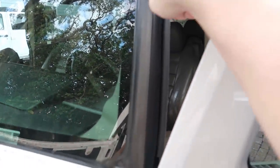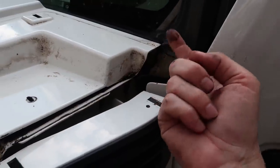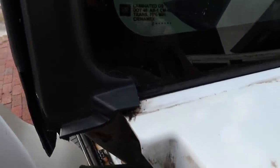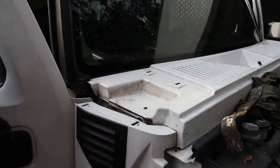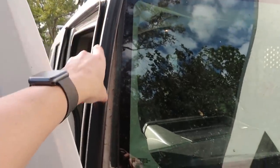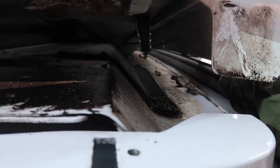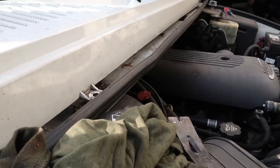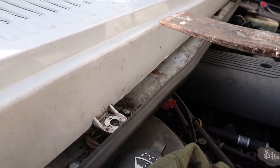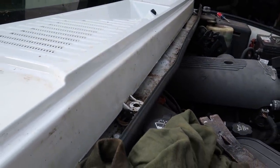Valuable lesson learned: there's a plastic trim piece that comes down the side of the windshield with a little tab covering the corner of the valance. When I was initially prying over there, I pried up onto that and snapped it off. So before you start prying in that corner, remove that trim piece first — it only has a couple of star-style screws. You don't even have to pull it completely off; just loosen it enough to move it out of the way so it doesn't get broken. Then you can look down and see exactly where the friction pin is and pry it out properly.